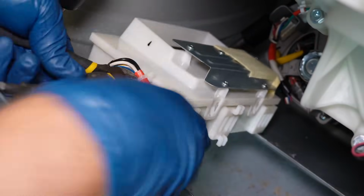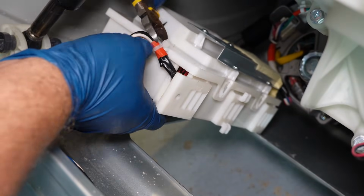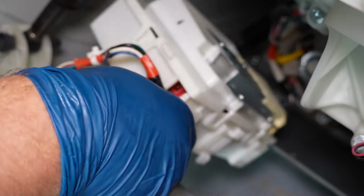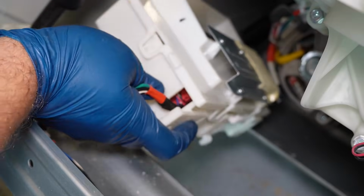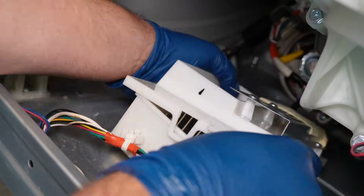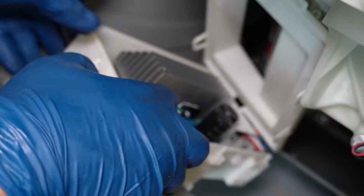These boards require you to remove cable ties, the cover, and wire harness from underneath before you can actually remove the board to replace it. There are 6 small pieces that keep the cover on, so you need to use a small screwdriver or needle nose pliers to slowly rock the cover back and forth to remove it. This is not easily shown on camera, but is not very hard to do.